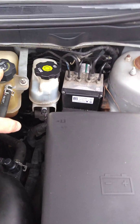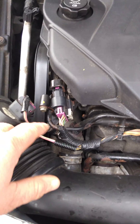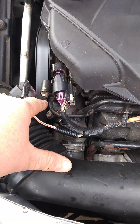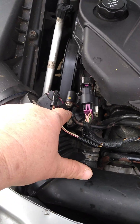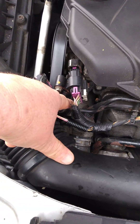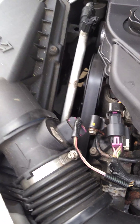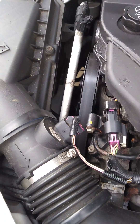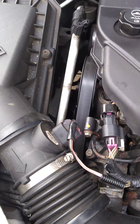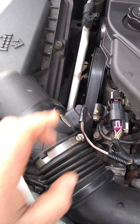So what I did — I left mine tight and came over to the side. I found a video where a guy said to loosen up this bolt here. I loosened it up and it really did nothing, so I loosened it up about a half inch and pulled the pipe out to let it bleed the air. I could hear it starting to hiss and dripping a little bit of water out. I let that run until a steady stream of antifreeze started coming out.